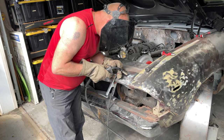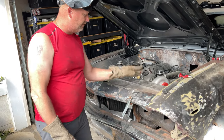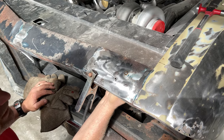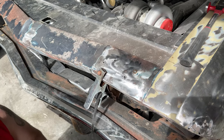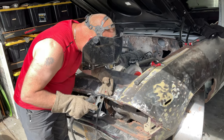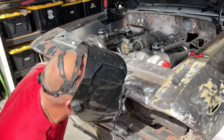Make sure you're grounded. And that's it - that's how you weld a hole. It really is just that easy. Then you repeat the whole process. We're not going to be using the Chevelle emblem - I decided just the little gauges - so I'm just going to weld them up. That way it's cleaner, and if somebody wants to add them later when they buy the car, that's on them. No burn-through at all - it's just so simple. Just keep moving it around.